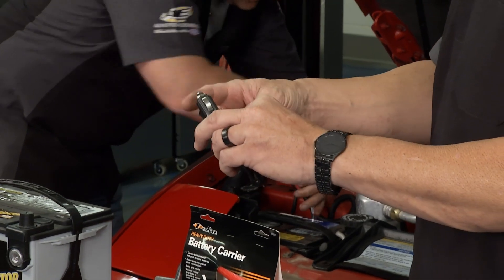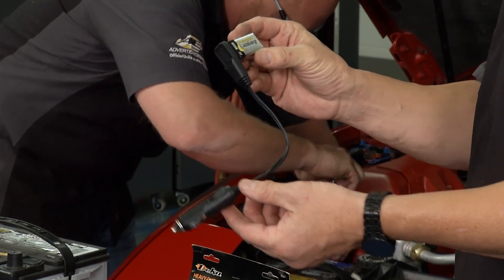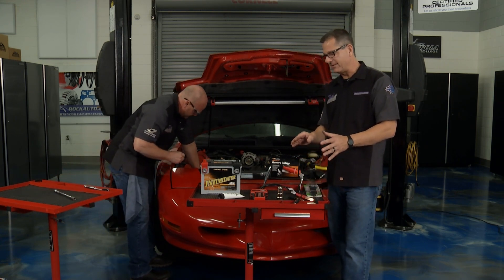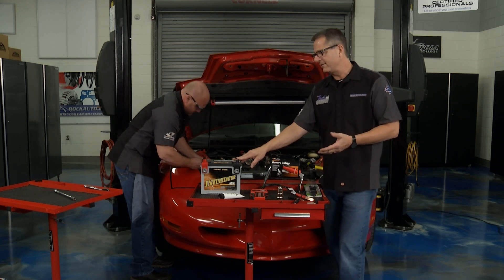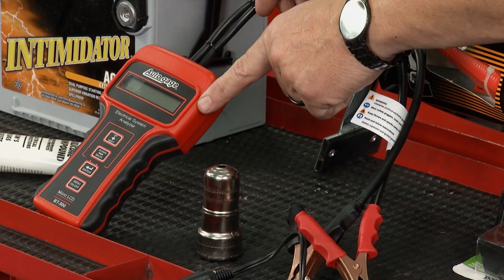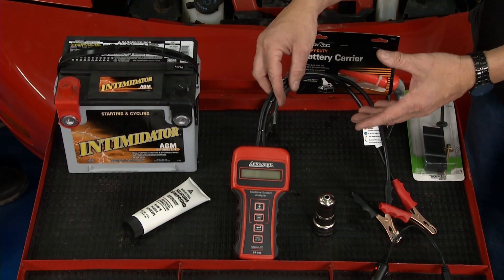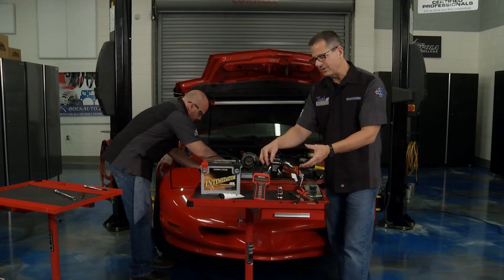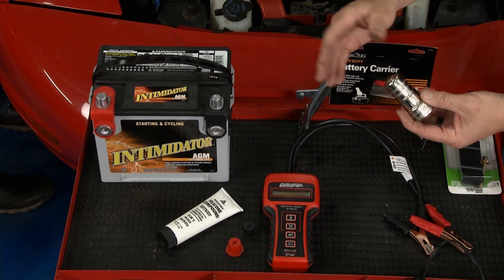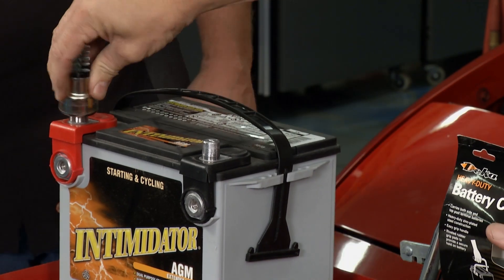RockAuto has a new battery, let's go ahead and get it started. Before you do that, put in this memory saver — a little nine-volt battery connects to it and you put it in the cigarette lighter. It back-feeds electricity through the system to preserve adaptive learning, shift memory, radio stations, seat memory, and all that stuff on newer cars. Brandon, a visual inspection isn't going to tell you a lot — you want to use a tester like this AutoGauge right here. It does a load test on the battery, gets into the plates, and shows whether the battery can hold a charge or not. Simple to use, just follow the prompts.